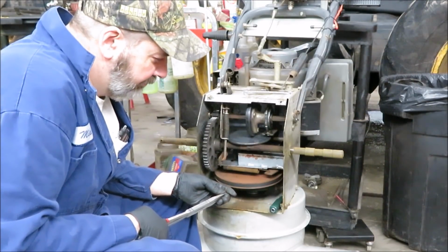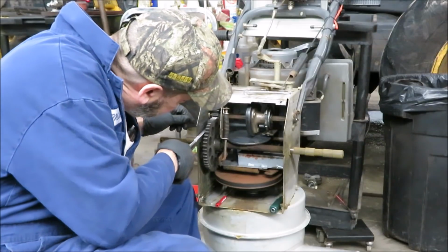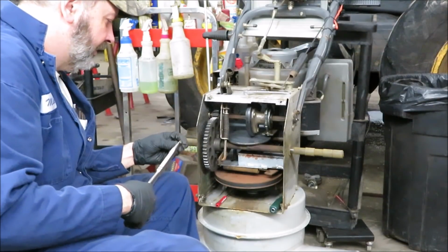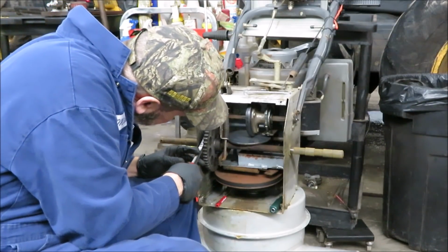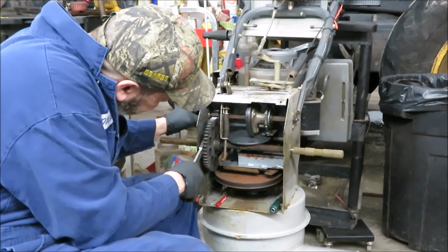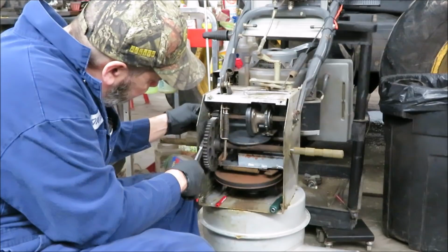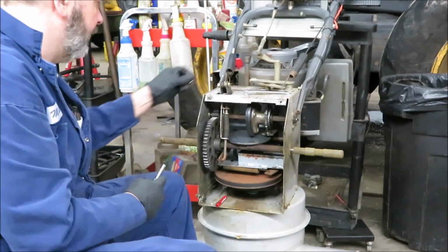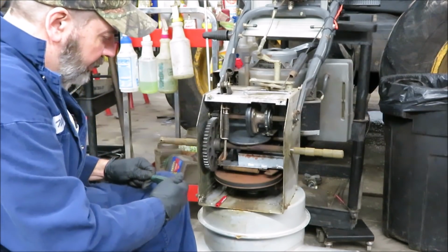Well, it turns out it was the wrong problem. There's a real small wire that goes through the harvester head up to the encoder, which is what counts the length of the tree as they're harvesting it. It tells the computer when to stop the feed rollers. So I went back Monday morning and finished the job. So it's running, it's all good. I just was having a little fit there. Not too big a deal. But that's how it went. That's how we rolled that day.